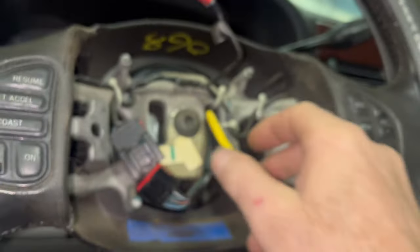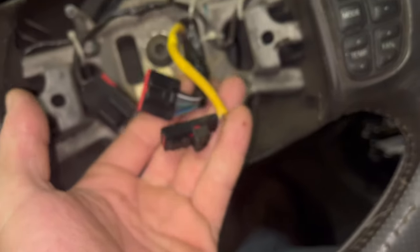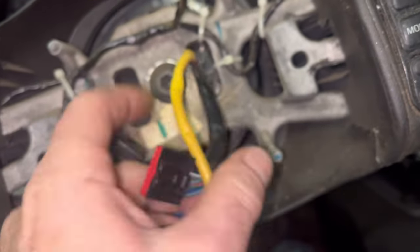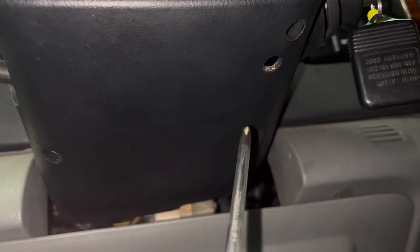All of this comes with the clock spring — disconnect this little guy right here. Now when I pull the steering wheel off, this stays with the truck. You have to fish these plugs through this hole right here when you pull the steering wheel off. We'll take a phillips — one right there and one right there — and that hole right there will let you pull out the ignition.